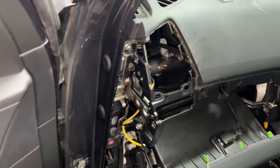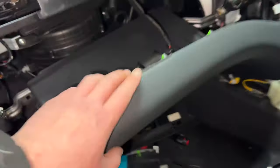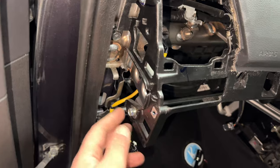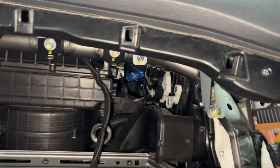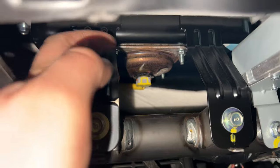Undo the Phillips screws and it'll pull out. I've got a 10mm nut just there, a couple of Phillips screws just in here, a bolt just here, and then this lower piece will pull off. I removed all those screws on the side, took the vent out, and then those two bolts at the bottom — this then pulls towards you. There are just two plugs: one for the actual glove box light and there's a wire at the back for the glove box switch. The remaining nuts: a 10mm bolt here, a 10mm nut just there, and underneath you've got these two. Then I'll be able to lift the dashboard off the actual dashboard frame of the car — when I remove these bolts I just need to undo that airbag plug at the back.